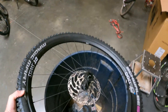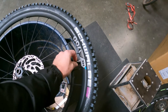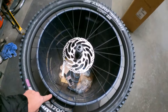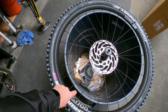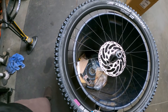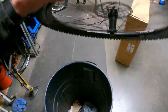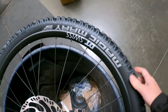The easiest way — a trash can makes it easy if you've got a 55-gallon drum hanging out. Let the air out. Once you do that, we're going to have to pop the bead on this wheel to get the tire loosened up. You're going to want to push down the bead until it pops down into the center, all the way around, and then do it to the opposite side as well. It'll make things a ton easier — otherwise you'll just fight the tire the whole time.